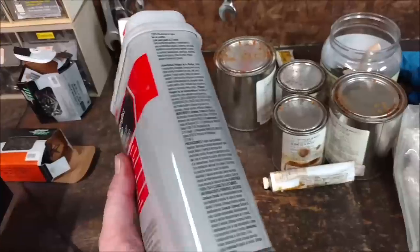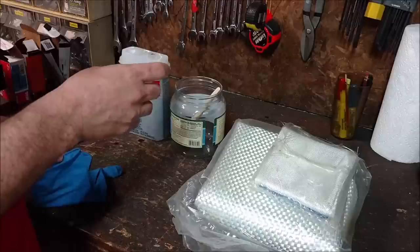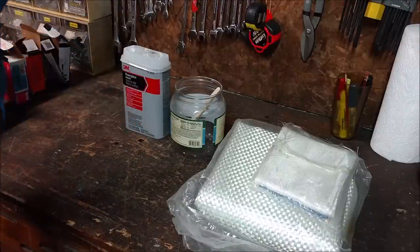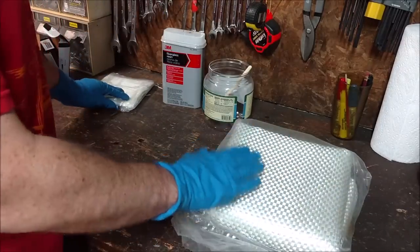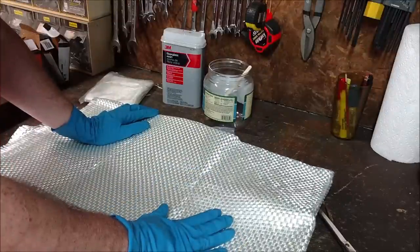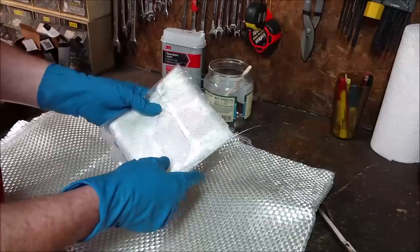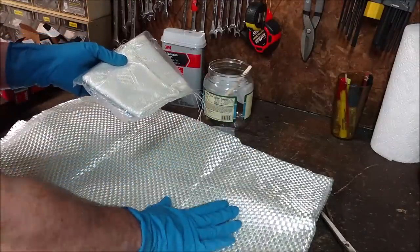I've got this other stuff that's a little less old. It's still liquid. Fiberglass can be pretty nasty, both in the actual cloth — which is full of tiny little fibers that like to get under your skin — and of course the resin, which is a two-part mix of one horrible chemical and another horrible chemical. So you don't really want to get it on your skin when you're working with it. It also sets up pretty quickly depending on the temperature — the warmer it is, the faster it'll harden. I'm going to cut out some strips of this cloth. I'm starting with this larger, heavy-duty cloth for the stern, which is going to be a little more structural. This is pretty thick stuff — what you'd probably make an actual speedboat or RV out of. This little thin cloth is more what you'd use for repair on a smaller hole, so I'm going to save that for some of the smaller holes in the boat.